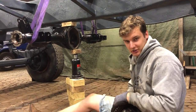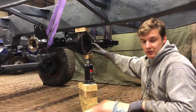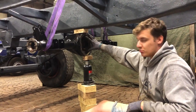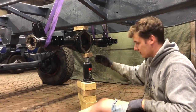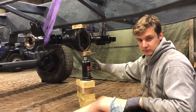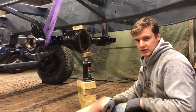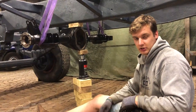The pinion gear is installed and sits very well. Now onto the second part: installing the ring gear. Like I said, there's a special tool to compress the housing — we don't have that — so it's the exact same lift that will push up and compress the housing, hopefully, so we can install the ring gear.